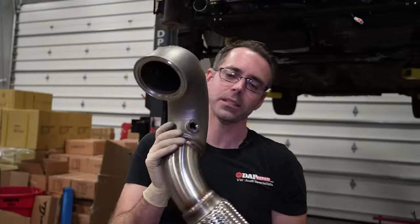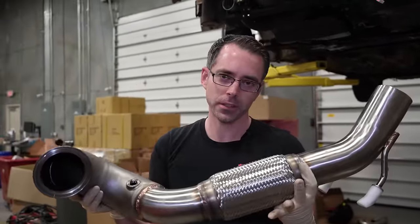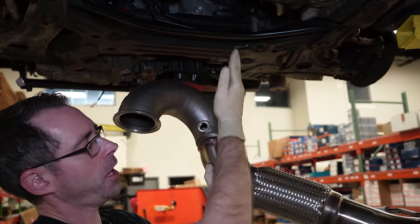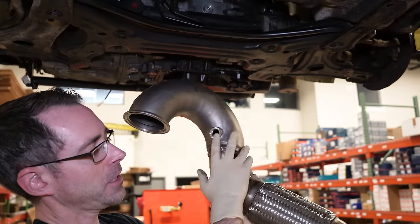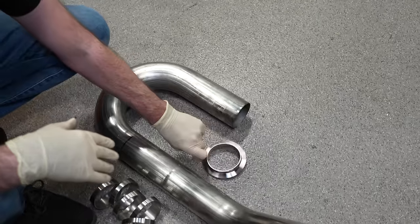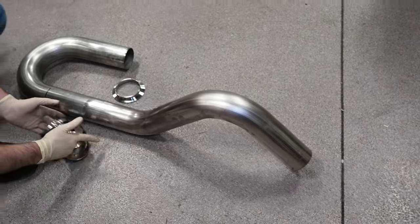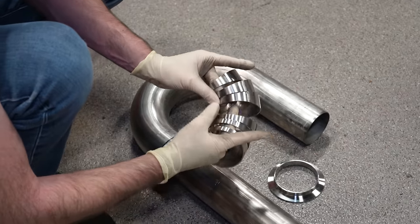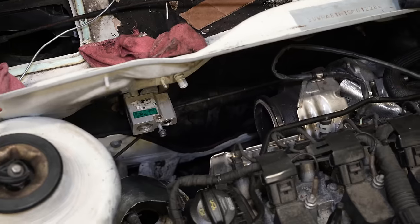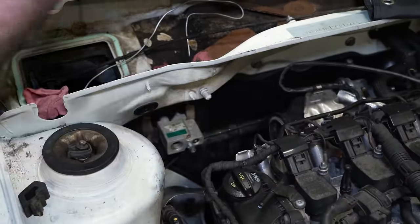I bought a CTS downpipe hoping we could modify it slightly to work for this car, but we don't have a very good angle — this needs to come straighter up, as opposed to forward, so it's basically useless for our purposes. To fabricate our custom downpipe, we bought a V-band that goes to the turbo, a 180-degree bend, a 45, a 90, and pie cuts to get all the adjustments we need. The 180 is where we start, to turn the flow toward the other direction.